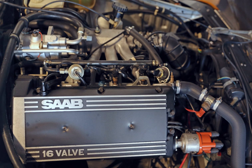In 1991, Saab introduced a 140 bhp 2.1-liter naturally aspirated 16-valve version of this engine, with an increased displacement of 2.1L — 129.3 cu in, 2,119 cc — and a resulting name of B212. The inlet manifold was enlarged and redesigned for better and greater flow. The intake manifold and head from the 2.1-liter constitute a well-known replacement for 1985–1993 16-valve 2.0-liter turbocharged Saabs. Power increase is modest at stock boost but becomes much more evident at higher boost levels.